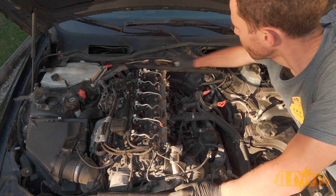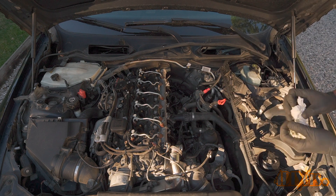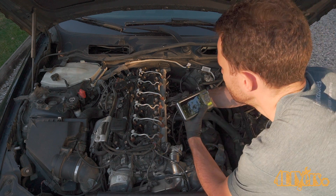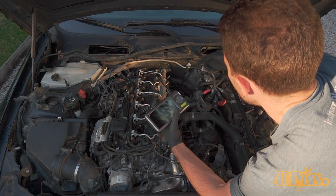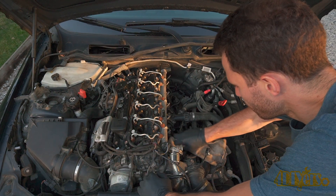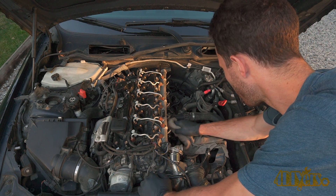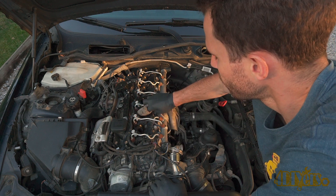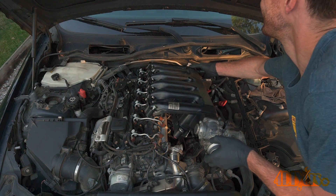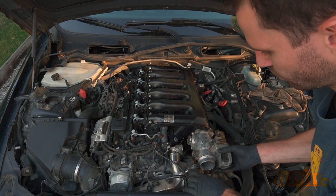The paper towel is removed from each of the intake runners and I'm using my Teslong bore scope to inspect each runner, making sure there are no objects which fell inside the engine and that most of the carbon buildup was removed — a link to this bore scope will be in the description. The sealing surfaces for the gaskets are also cleaned on the engine side; Scotch-Brite can be used on the head and a light degreaser with a clean cloth on the valve cover. The intake is then installed back onto the engine — use a flashlight to make sure all gaskets are properly in place.